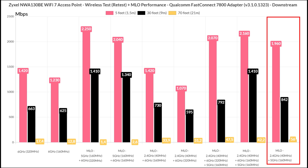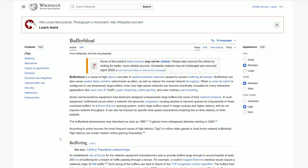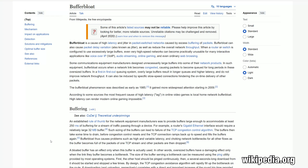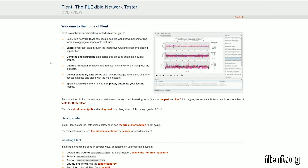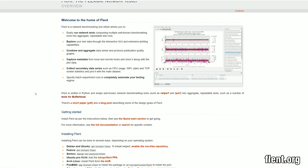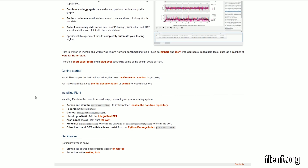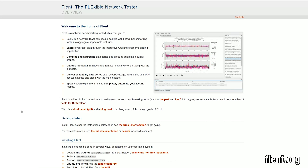Bear in mind that I tried to keep interference to a minimum. I also wanted to check whether there's an impact on latency when using multi-link operation. Since I didn't want to lose my sanity running NetHydra tests for at least a week, I decided to rely on Flent — a very versatile tool developed to measure buffer bloat. It uses Python scripts to run multiple open source tools such as iPerf or NetPerf to generate traffic, collect the data, and display results in a user-friendly graphic.